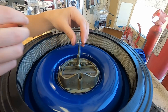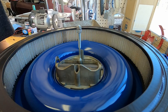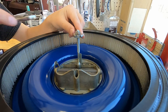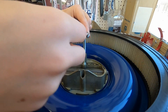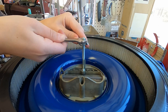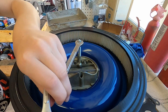We are going to make this stud be the perfect length. To do that we need to run it all the way down into the carburetor. We've got it as far in as it will go by hand but it feels like it's still wiggly, so we're using a small trick. The trick is to take two nuts, tighten them against each other, and then you can use the top one as a bolt head to go ahead and run the stud all the way in.